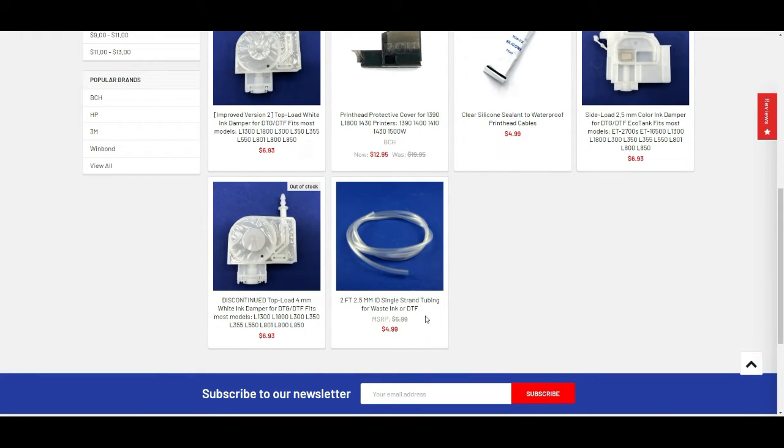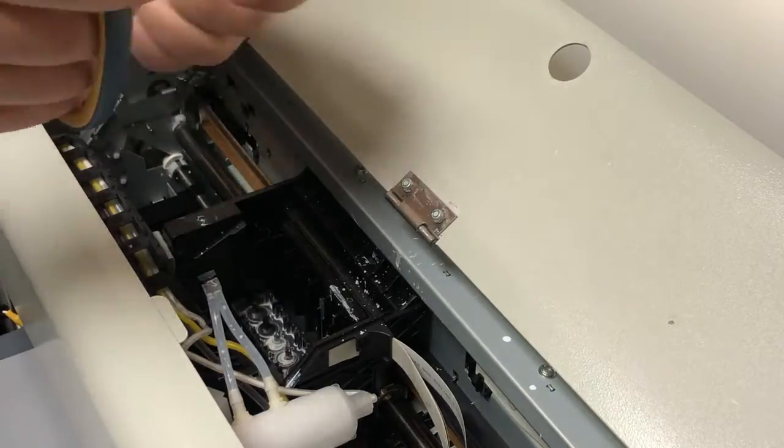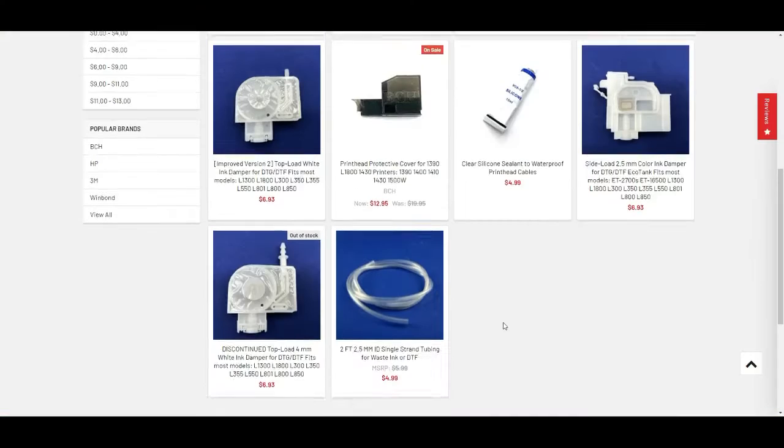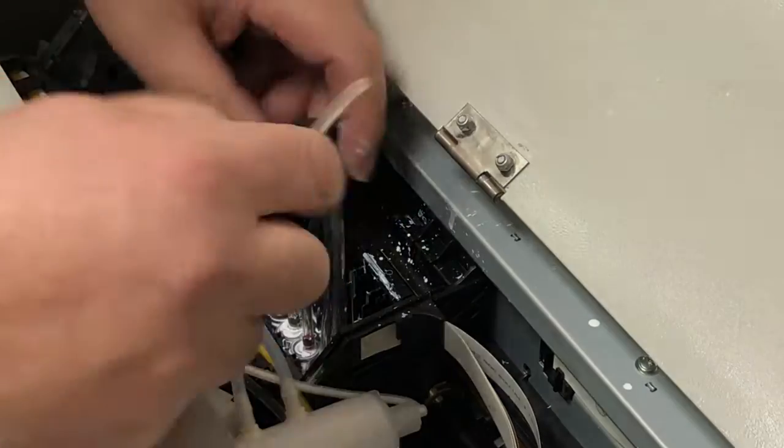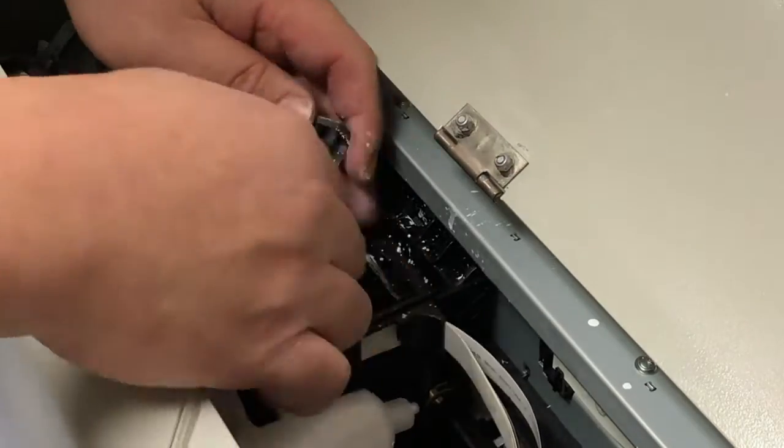Now we're going to take two feet of this tube — each order is two feet, so you need to make two orders. First, the two feet of tube we're going to cut into six pieces, and we're going to insert each piece onto the nipples on the printhead. Now we're going to use this one-to-six manifold. If you do not want to do all the colors — because if the other colors are not clogged, only the white is clogged — you can use the one-to-two. But for this printer, I found that the color is also clogged, so I want to clean them all together. This one has six inlets or outlets on it, and then there's one inlet in the middle.